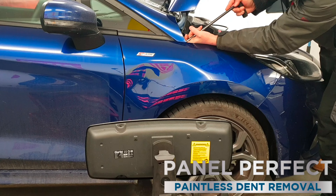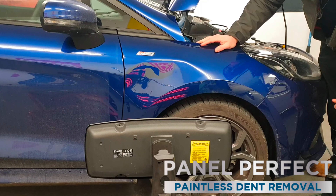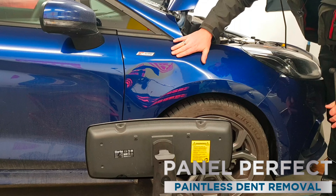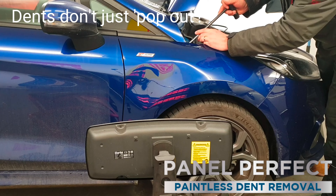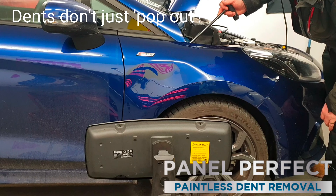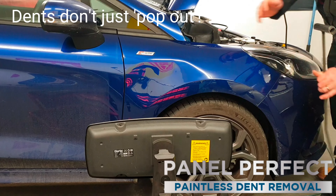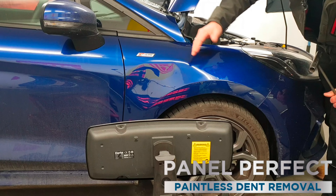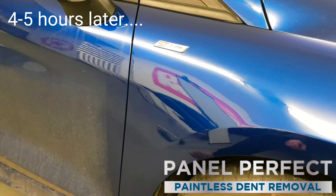At the moment I'm just using the natural reflections of what's around me. As you can see, that's the main pop. I may get a little bit more cranked out before I need to move the metal back into shape. As you can see it has quite a bit of bounce and stretch to it at the moment, so I need to get some strength back into the area. I'll do that by releasing this crown and drawing it back into the metal so it will hold its shape a little bit better. But that's the initial pop which everyone talks about. It hasn't released a massive amount, but I'm going to deal with this crown, push the metal back down into the damaged area to strengthen it back up, and then we'll keep pushing from there.